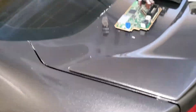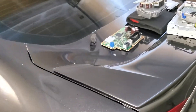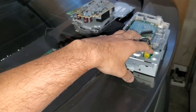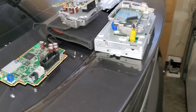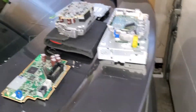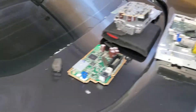The bigger chip is the brain. My car had a problem where it was having a navigation fault, and I tried to fix it by changing the APIM. This is my original APIM — I swapped it with this one, but then this one had a fault too. It completely froze and the touchscreen wouldn't work anymore.